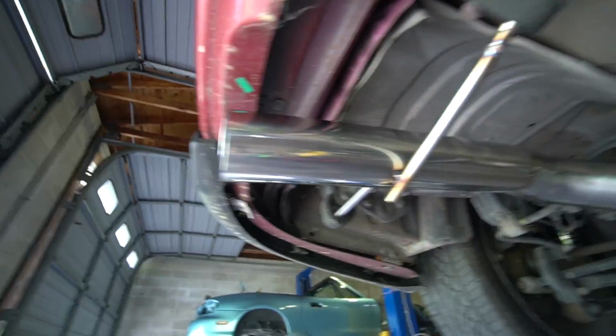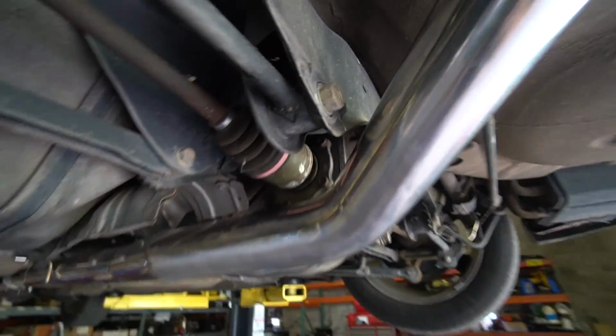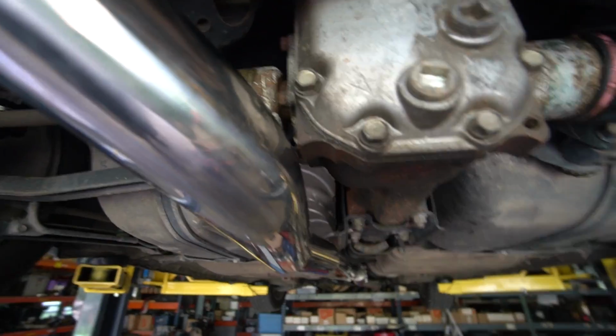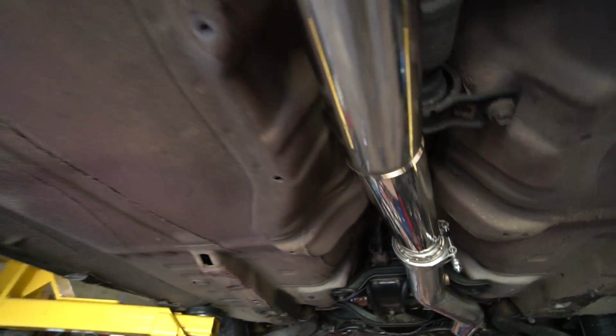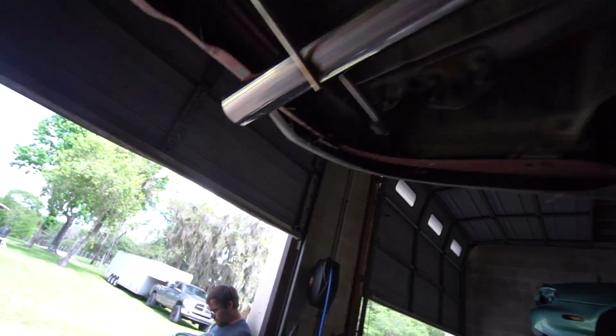But yeah, so tip, 45 down, 45 through here. Nice tight fit, real close to there, real close to there. And it kind of kinks back over, comes down, kinks over, and up to the downpipe. Gonna unbolt it, pull it out, and just weld all these pieces up.